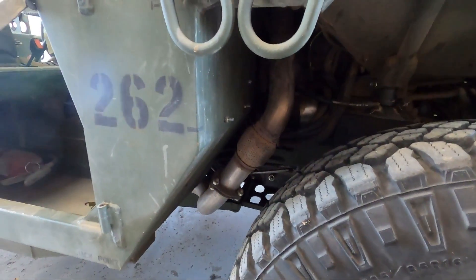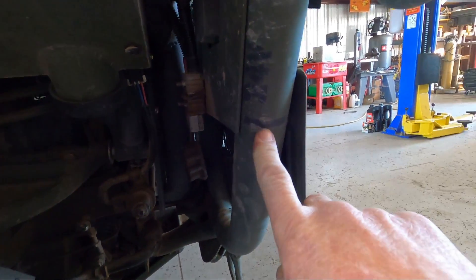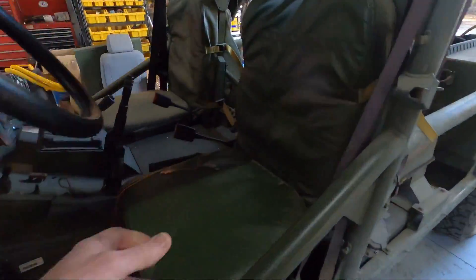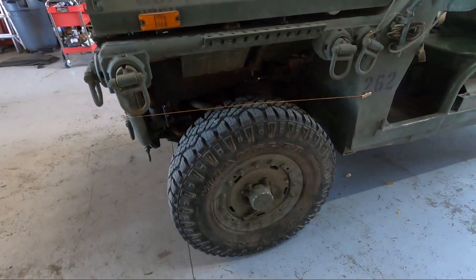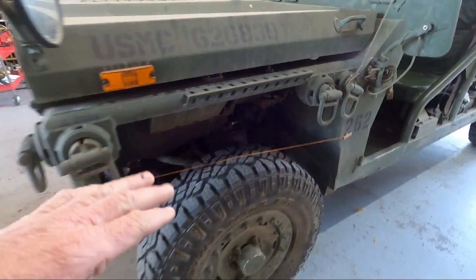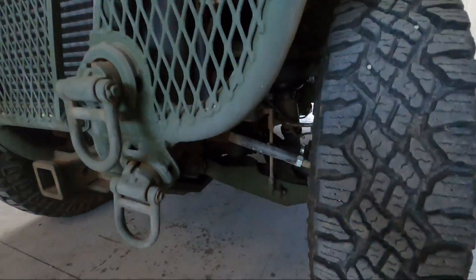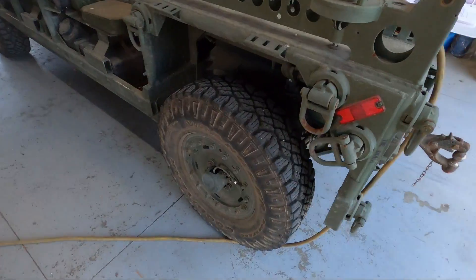On most Growlers this mark should be present, but I have a couple out in the yard that don't have the marks because they were repainted. On one of them they put the marks in the wrong spot. Those marks are to set the level for ride height. What I've done is put two magnets on a string. With the string resting right on top of the tire at eye level, I actually lowered the body down just about a half inch below what the manual says - I wanted to get my CV axles as straight as possible at ride height.